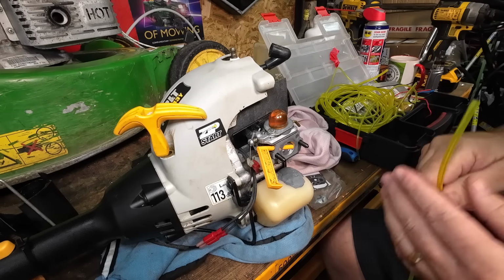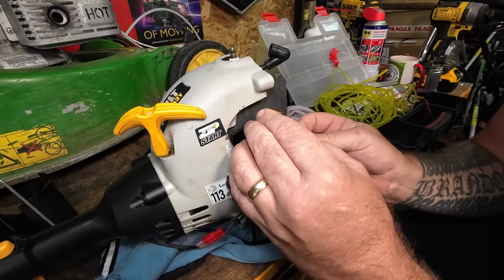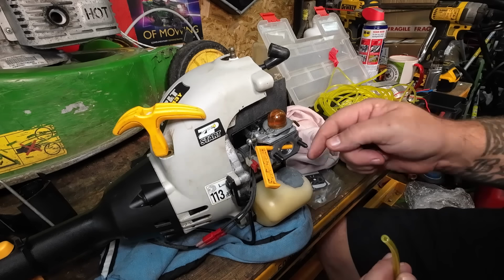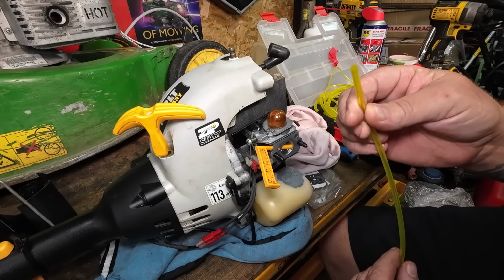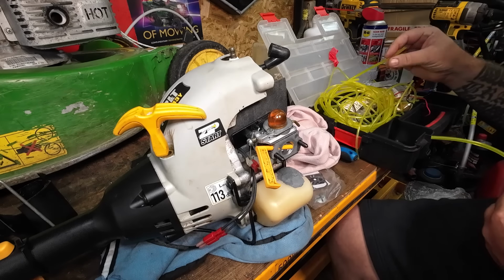on the carb. So that's not a bad little size. Let's look at that. Yeah, that'll go on there nice. That'll go on there nice too. Yeah, right. So that's going to be the fuel hose I'm going to use. I'm going to find a drill that's just slightly smaller than that. Drill just down the back of here, to take these fuel lines in. Nice snug fit. I have to push them really tight, and then that will do it. So that's a nice fuel hose, that is.